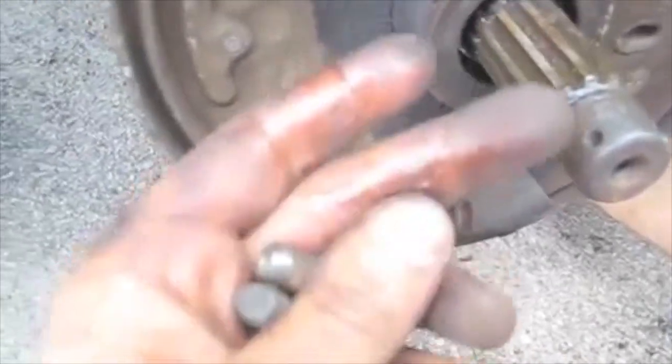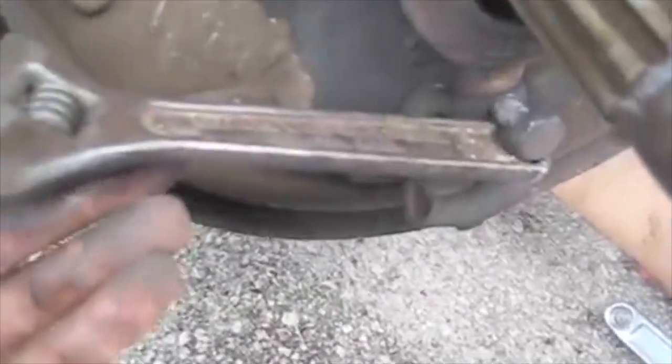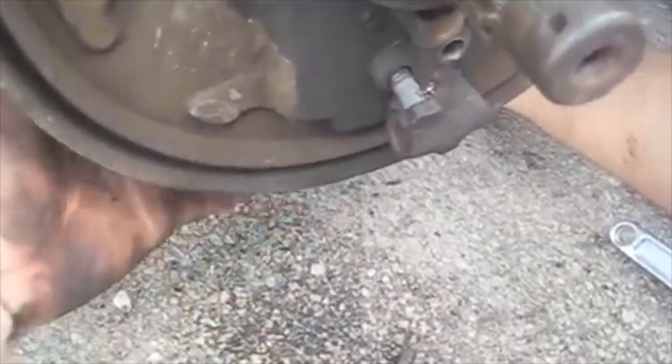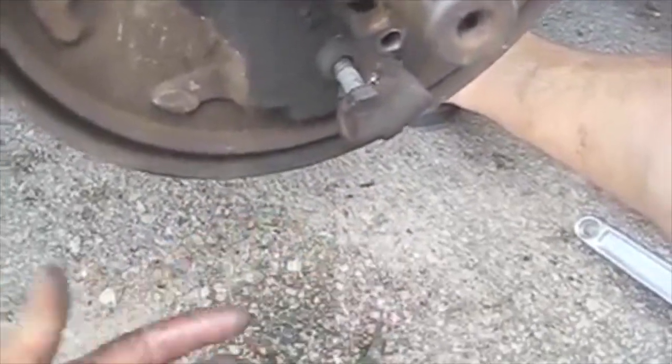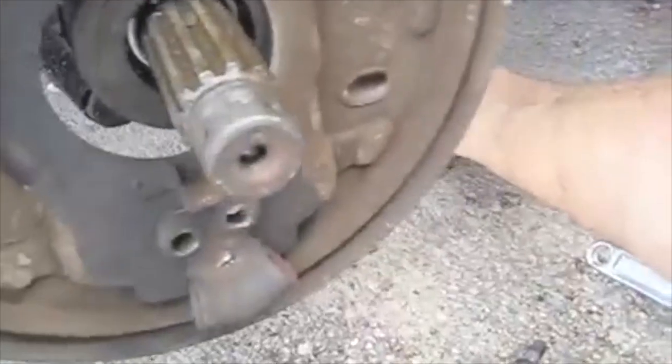That completely sucked. After putting the blaster on it, beating the hell out of it from both sides, and putting heat on it with my little butane torch — which doesn't produce a lot of heat — what I ended up doing, same as the other side: I put those screws in a little bit, put my wrench in and basically stood on it. On the other side I tried getting a flathead in there from the back and just ended up screwing up the backing plate. After doing that several times back and forth, I just pounded it out from the back — that took like an hour. If you had some high-power torque, that would probably be a better choice.